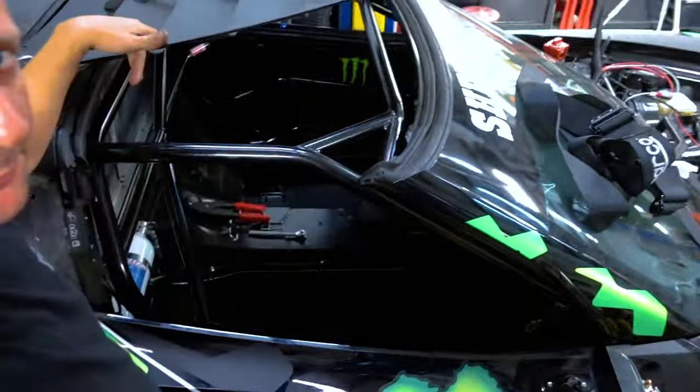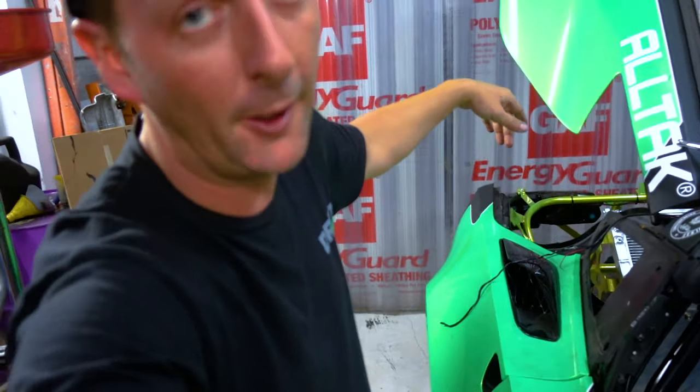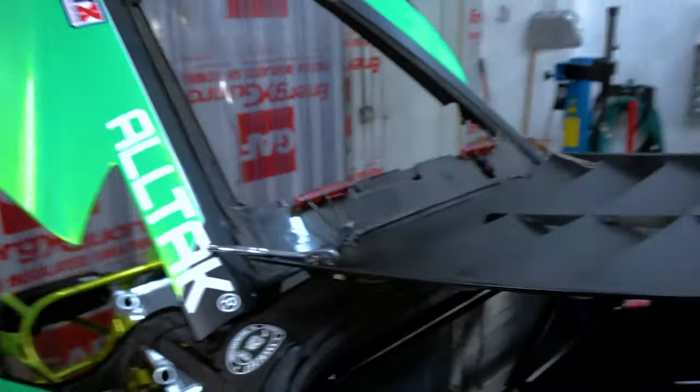Craig just has to make a few pieces for the ducting. We're probably not going to bring the ducting all the way to the trunk lid since it's not really necessary — we're mainly trying to keep tire dust and debris from accumulating on top of the radiator and clogging it. I'm going to remove this louver as it's not doing the radiator any justice, and then after Chris finishes the wiring, I'll start working on the ducting up to the trunk deck.